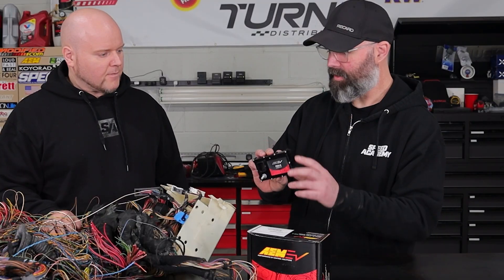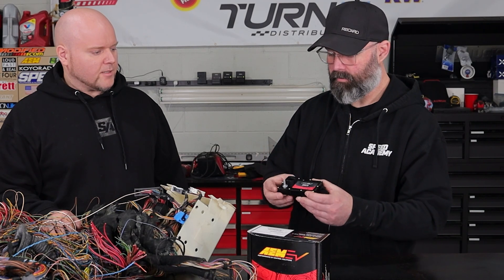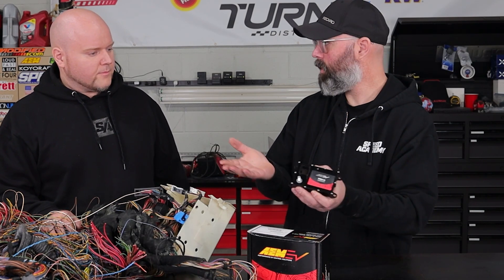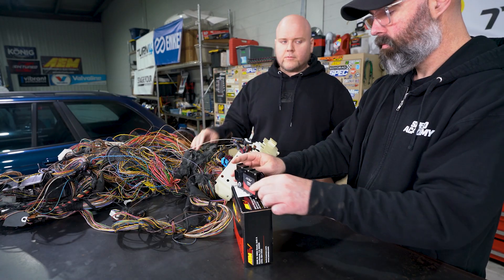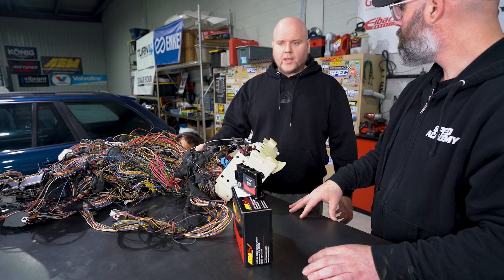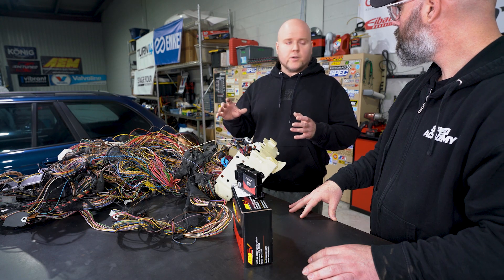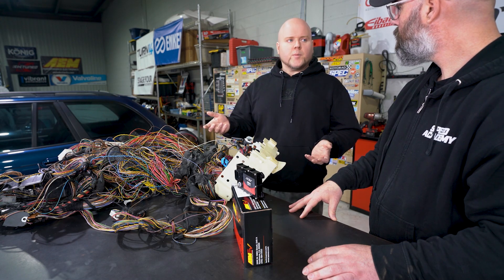It's also remarkably small, isn't it? I'm used to seeing PDMs that are much bigger and heavier than this. And that is part of its appeal as a satellite setup — you can put it in places where you wouldn't normally fit a larger one. These are only 8-channel; most PDMs you can get 16, some even 32. But if the whole idea is that it's designed to run some localized part of the car, that's perfect — you don't want a big box where you're wasting a bunch of outputs.